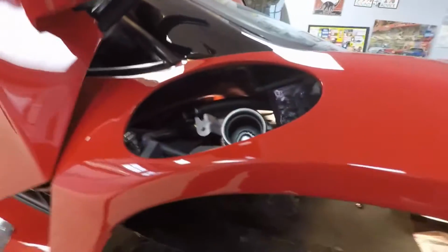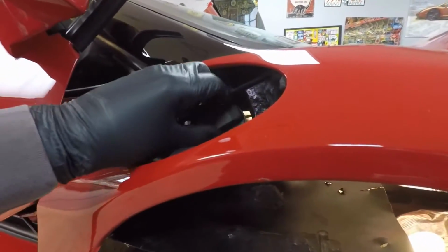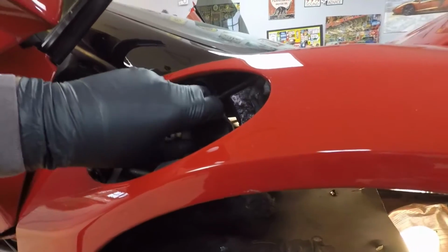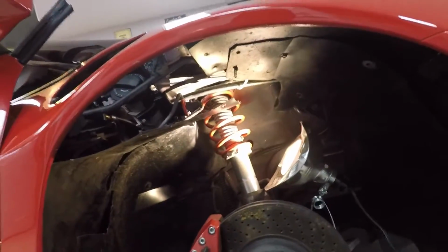So all of a sudden I have the notorious can't fill up the tank with gas, like thousands of other Porsche owners. So the one thing I figured out is when you push that in, you should hear that one valve clicking. And originally mine would not do that. So it's one of two things. There's not much going on between that and those sensors. So the sensors are bad, or this little part was bad.